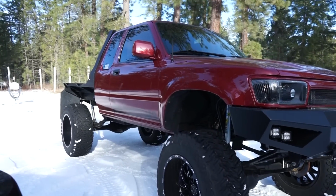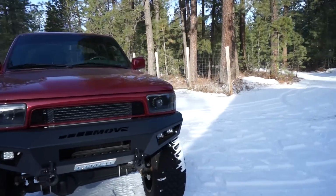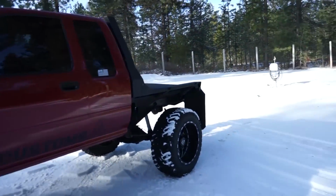I still need to adjust the IQ. It's at like 6, where it should be around 4. Timing is around 62, so that should be good. So a few little adjustments to make, and we should be dialed in. All right, guys, we finally got a nice day out here, so roads won't be a full sheet of ice. So we've got to run out and send over a couple logs to the truck and then see what else needs to be dialed in on it.